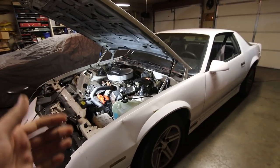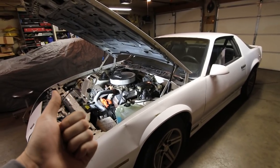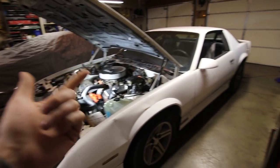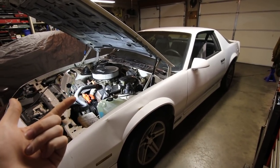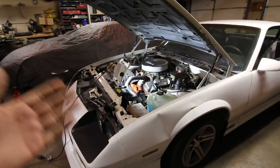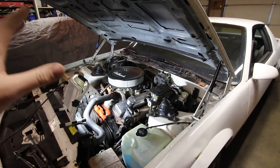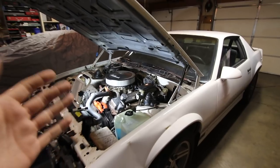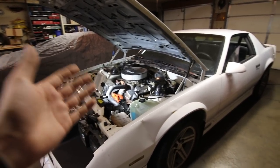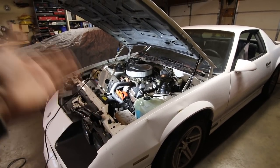So there's one of two things that happened. My driveline angle is now wrong, the pinion angle, I guess you'd call it, or I'm now, for the first time, noticing that my drive shaft is crazy out of balance, or something like that. It's actually transmitting things into the car that the old rubber torn one wasn't, because that one was almost severed, so I probably missed a lot of it in the first place. I expected to pick up some vibration, but this is kind of annoying. I didn't film it last night, and usually I like to go drive stuff a little bit before I waste time filming, and you know, it's just more dead footage.